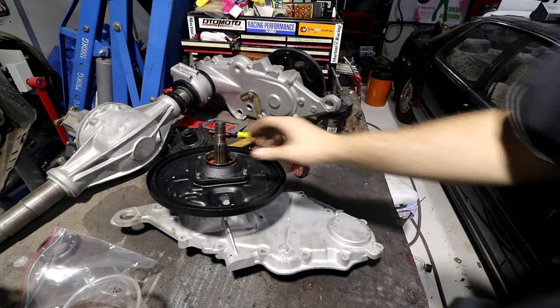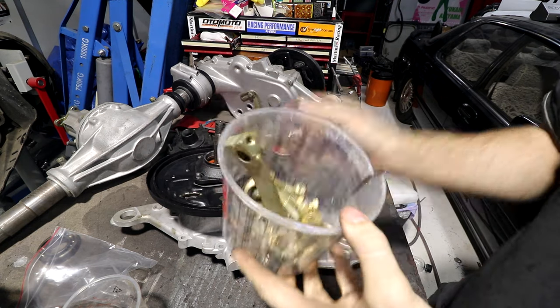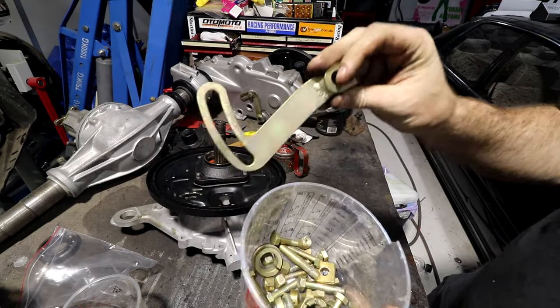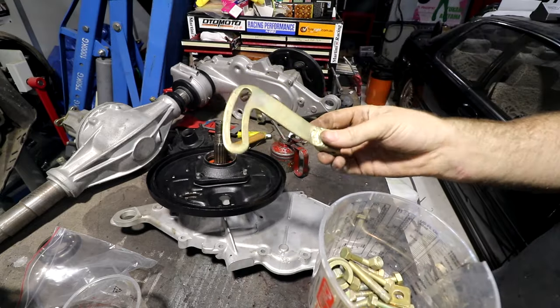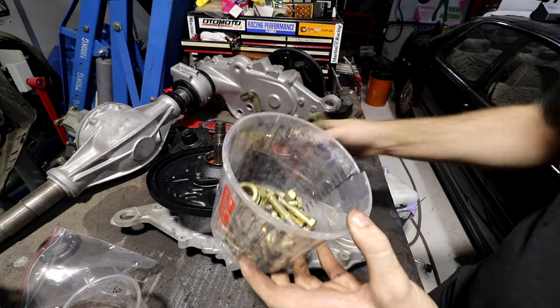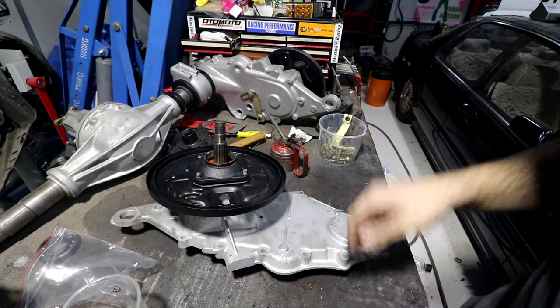Now we're ready for some nuts, which is kind of exciting. This is my bucket of all the external hardware. These have been zinc electroplated, which is what they were supposed to look like when they were new. Obviously these were all rusty when I pulled them apart. I zinc electroplated these at home myself. There's a video on my channel if you want to have a look at how to do home zinc electroplating. So we'll pick out the nuts we need for this and bolt it up. Once again, the manual coming in handy here.